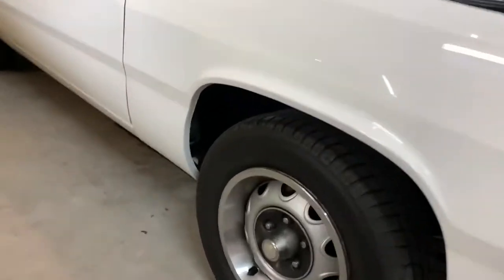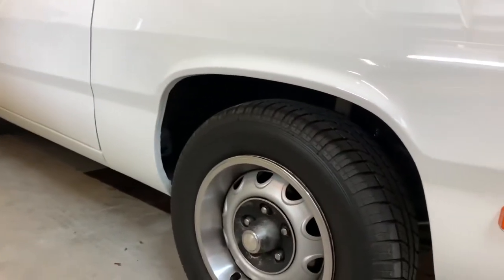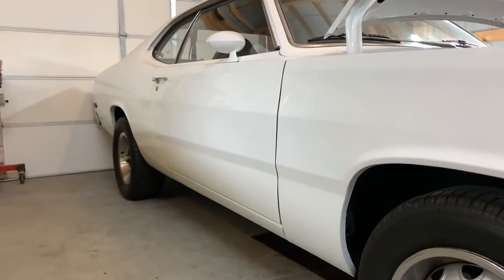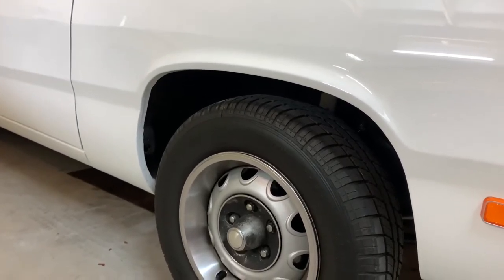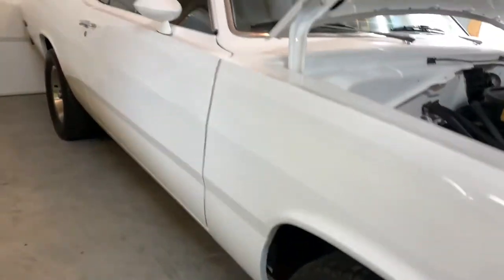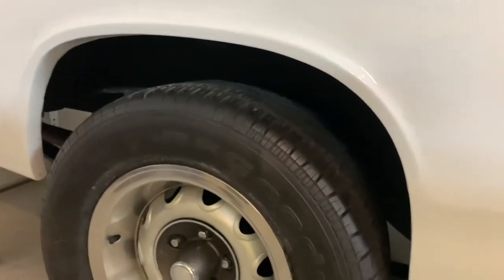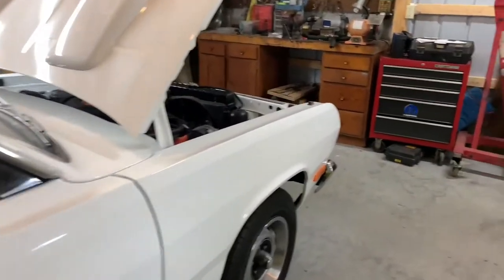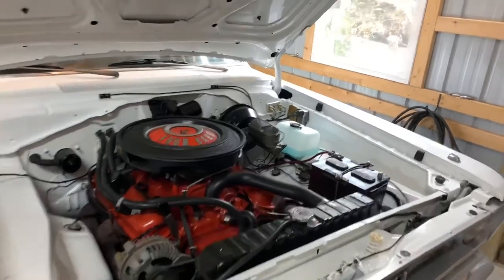The first tip is tire pressure. I usually like to run as high a pressure as I can on the tire safely at the track. I usually run 45 PSI in the front and 40 in the rear, as long as you're still getting traction. Tires roll easier if they're inflated to a high pressure. If you're running regular radial tires like these BF Goodrich Radial TAs, they actually tend to get a little better traction with higher pressure — run them real under-inflated like a slick and they tend to actually spin more.